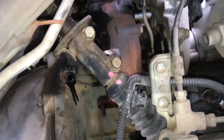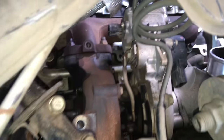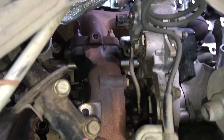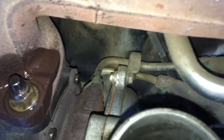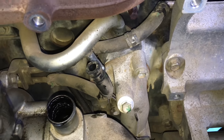The oil supply and return pipes are off. There's a coolant line on the other side of the turbo — we remove those hoses further up and that pipe will come off with the turbo. Probably just the three bolts at the top bolting the turbo to the exhaust manifold left now — two closest nuts and there's a hard one to get to at the back. Give them a spray. We should be able to manoeuvre the turbo out up through the top. Re-spray those nuts — one is visible from this side; the other you have to access through the hole.